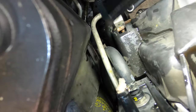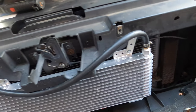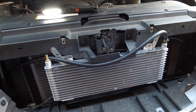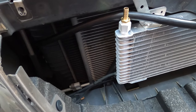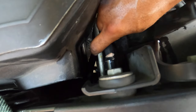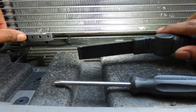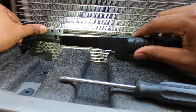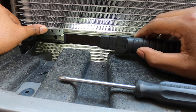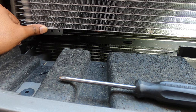I got the first line connected — this line is the internal transmission cooler output running to the top of the external cooler. That used all four feet of hose, so now I need to go to the auto parts store and get more 3/8 line — probably another four feet — to run from the outlet back to the return line to the transmission. For the bottom mounts I have some metal zip ties that I'm going to use to secure it to the bottom support.